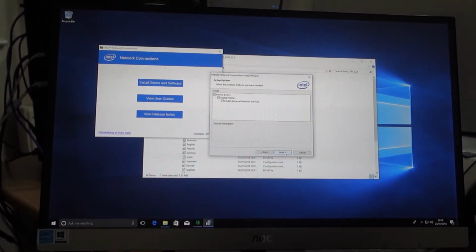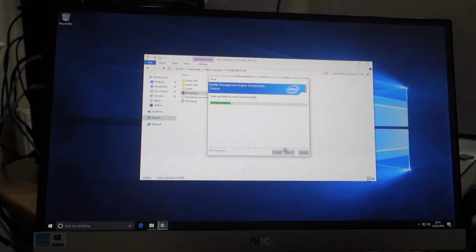Now, what I do at this point is go back to the motherboard website, in this case for ASUS, and I download things that are relevant. You don't need the audio drivers. That's something most people recommend disabling in the BIOS. You download the LAN. You download any custom chipset drivers. You download anything else that you think is relevant. But again, remember, you don't need a lot of these things. You need the essentials. You need the Ethernet driver. You need the chipset driver. You've already installed the BIOS at this point. And yeah, you've got that. At this point, what you have is a functioning PC. And there's a lot of other things that you can do.